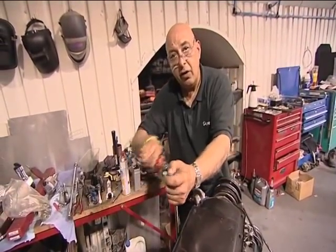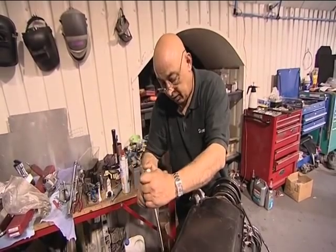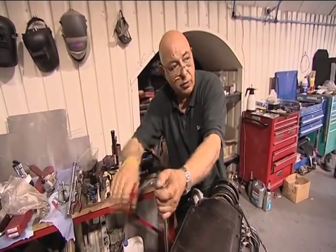There's no specific torque for the sump, but if you over-tighten it the gasket will spread and crack. That's why people who do everything up with air tools tend to have more problems than people who rely on just feeling the force of a bolt. Golden rule: use your arm and don't rely on air tools.